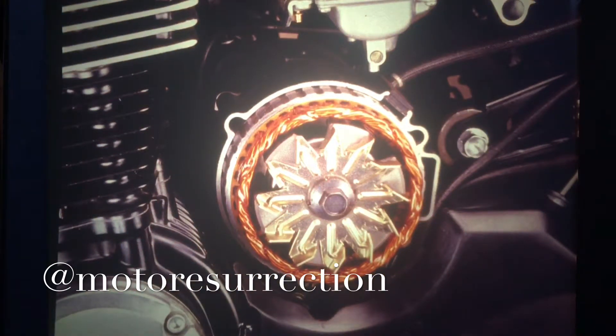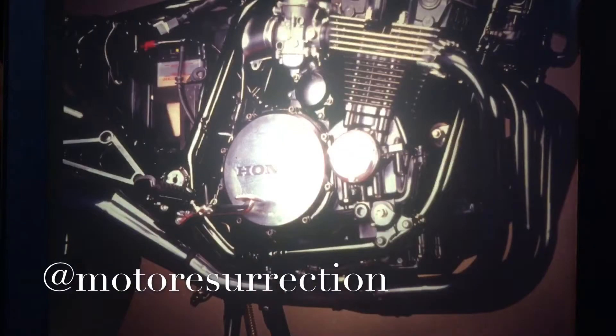The alternator is behind the block, as on the 650, but it's driven even faster, and it's air-cooled. The engine has a semi-dry sump, so it can sit lower in the frame. Crankcase oil capacity is less than the 650's, but the frame tubes and oil cooler more than make up the difference.